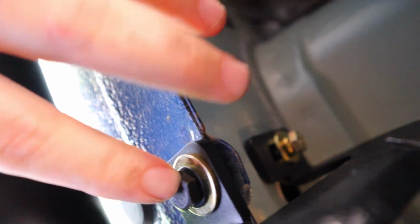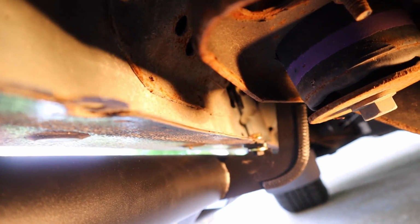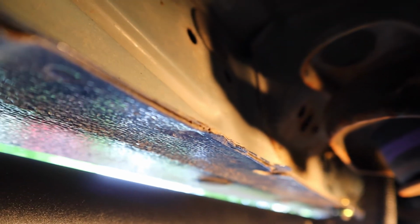We're bolted up there and there, one on the panel and one on the pinch weld, and we did the same thing down the line. So we got 6 sets of nuts and bolts, and the steps are hanging there. They're not secured down all the way because we want a little bit of wiggle room so that we can make sure everything is lined up, and then we're going to torque everything down to 17 foot-pounds, it says. So let me finish this up and we'll show you what we're dealing with.